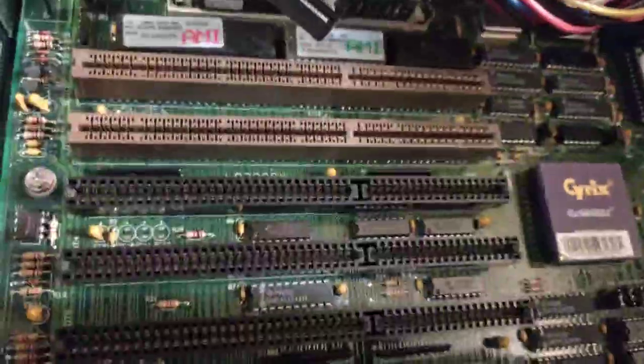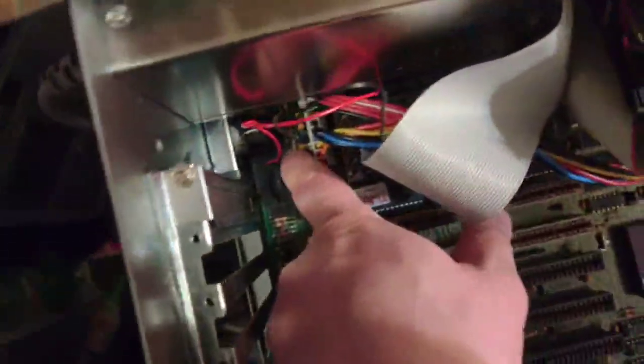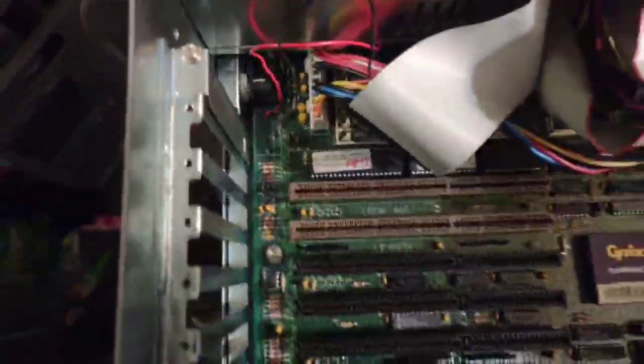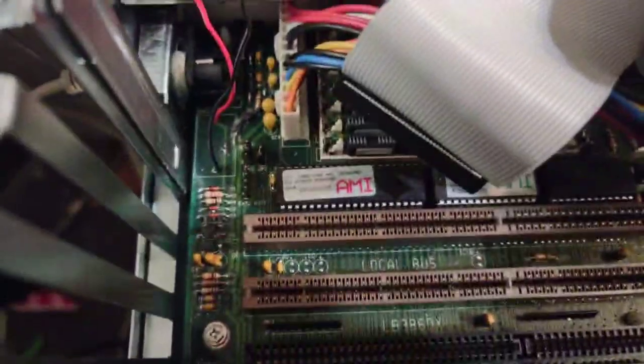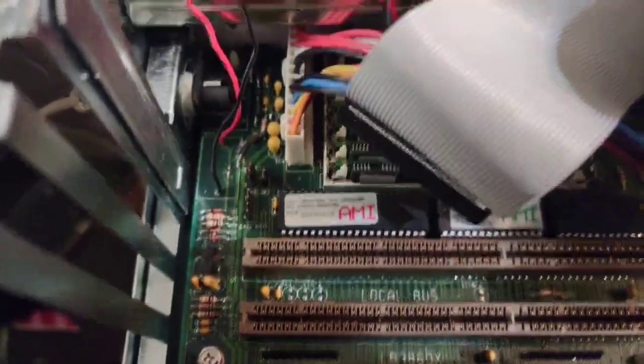And the other issue was the original clock battery that was right there. Used to be the nickel cadmium type. It leaked a little bit and put a little bit of damage right here on this one trace, that you can see this wire that I soldered on. It had really good contact still, but I didn't want to keep it, so I decided to cut the trace and start fresh again. Well, actually just solder it from one spot to the other, but I digress.